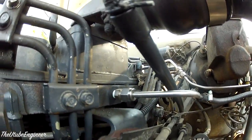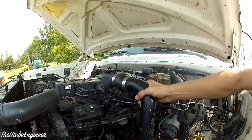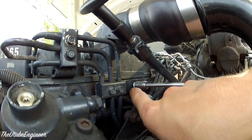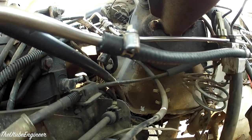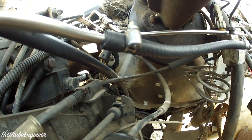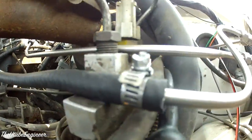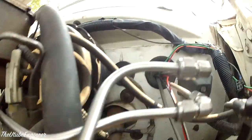The boost gauge is the same way. If you look at where the intake from the intercooler is, right beneath it there is also normally another 1/8th NPT cap. And I added a piece of hose just for some vibrational and torque flexibility, just because it is a lot shorter than the oil pressure one, which has a lot of degrees of freedom.